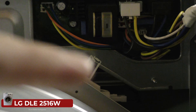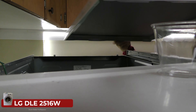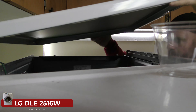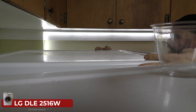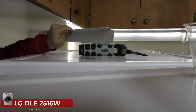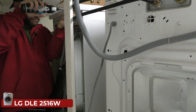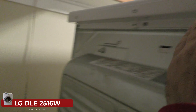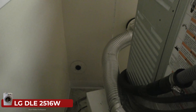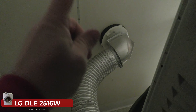I should have routed that one wire that goes to the door up through that clip and down through here, but I didn't — oh well. There are little plastic pieces that help guide the sliding activity. We're going to slide it on like that. With this bracket — it's hard to see but there's the bracket back here — we'll start the screws. One, two, three, four, five, six screws: the smaller ones go on the bottom, the bigger ones on top. There is a difference in the screws — this one's more silvery, this one's less.